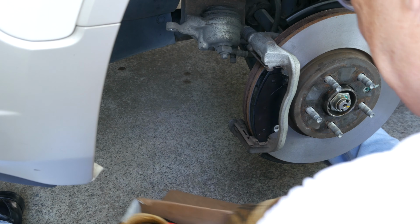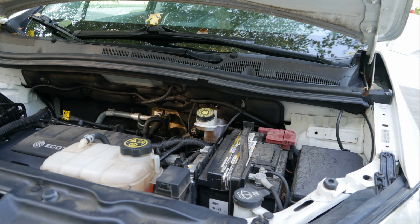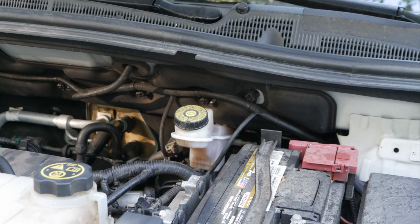As we set this pad aside to dry, locate your brake's master cylinder and remove the cap. If you don't recognize the term master cylinder, just locate the place where you would add brake fluid. Since most folks get their car serviced at a Jiffy Lube style location, the brake fluid is an item they routinely fill to the top.